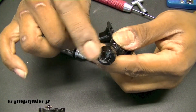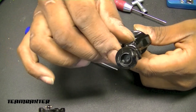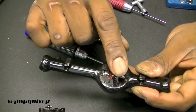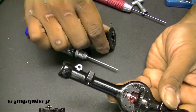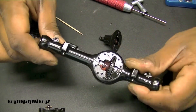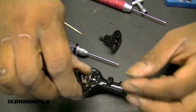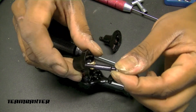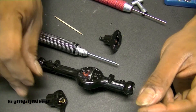I'm also going to put a little dab of grease in that dog bone slot to help things out, and red and tacky on the gears along with the pinion. Also while I have the knuckles out, I'm going to grease the little dog bone pin around the shaft, then put that back and get these axles put back together.